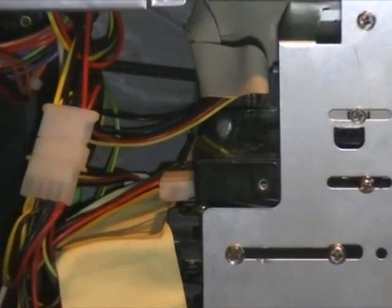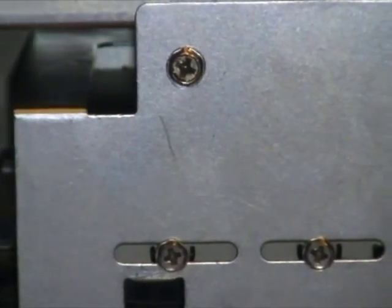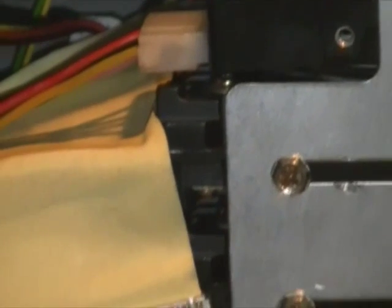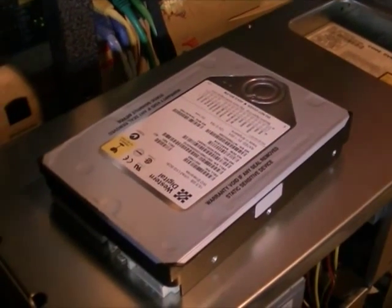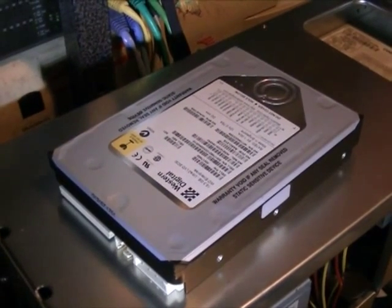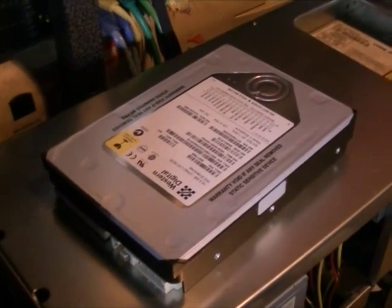Here are the hard drives and these are the first sign that something abnormal is going on in here. As you can see there's a floppy disk drive, a Maxtor IDE hard drive, and then this ribbon — and that certainly isn't IDE. It's Ultra 2 SCSI LVD, or low voltage differential if you prefer. The hard drives using this bus are Quantum Atlas 10K3 drives with a capacity of around 36GB each. I originally used 18GB Western Digital hard drives, but whilst restoring the system I found one had dead sectors — possibly due to the original bidirectional cable being faulty — so I replaced them and gave them a single-directional cable.